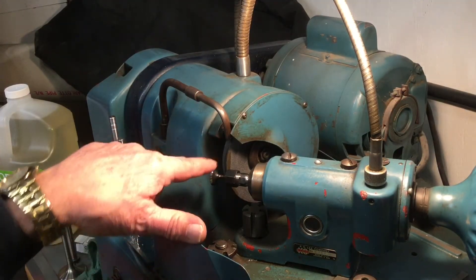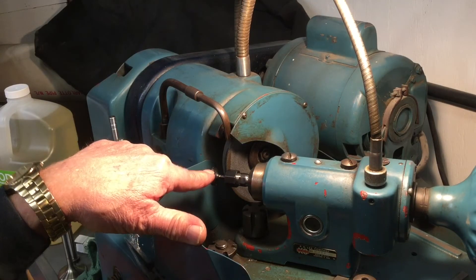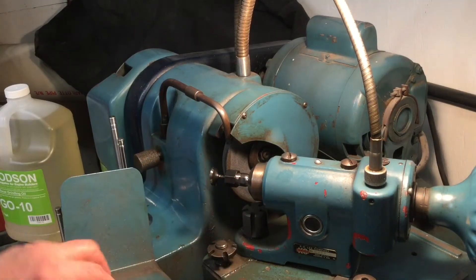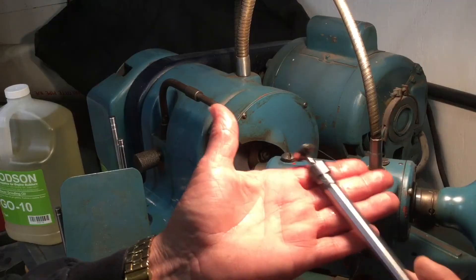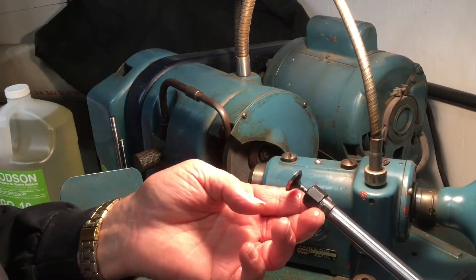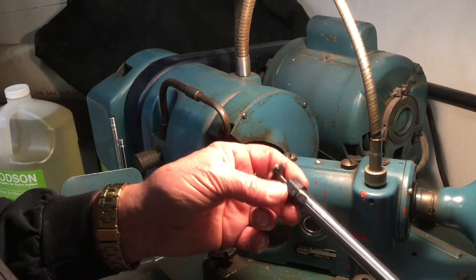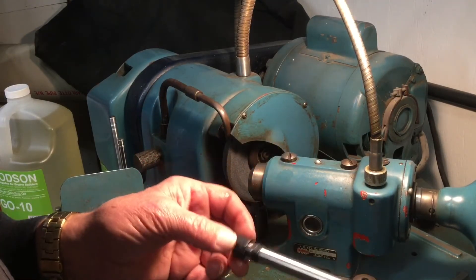I had it set at the right angle and was able to accommodate a 4mm valve stem inside a regular 5/16" chuck using the UVRC-46 Universal Chuck, available from Goodson Tools and Supply. Give us a call at 1-800-533-8010 or visit us on the web at goodson.com. Thank you very much — we'll see you next time.